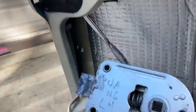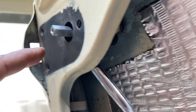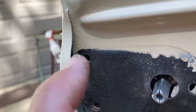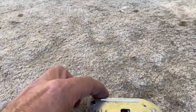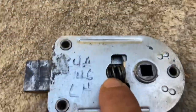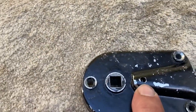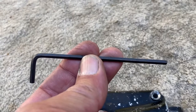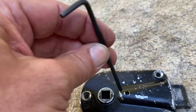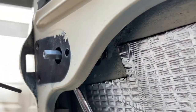You see this hole? The hole for the screw. Now that happens to line up really nicely for an Allen screw. Over here, no hole. However, that's just sheet metal behind the latch. Look at the back side of the latch. See the distance here with the opening for the spring? Flip it over. Notice the extra hole I made. Notice the slightly longer Allen wrench for the 10-32 screw. You force the spring out of the way, and now you've got access to both of these.